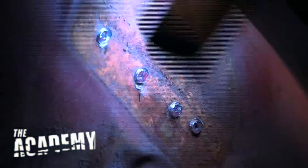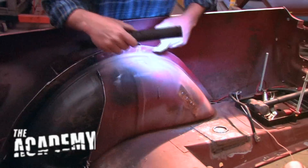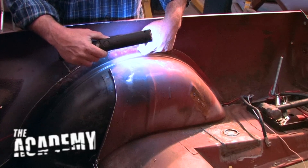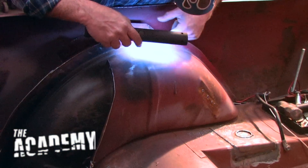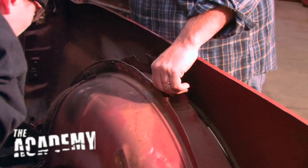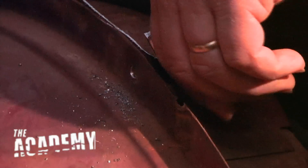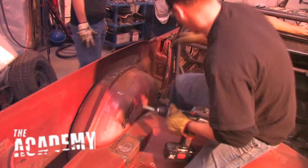You were through it enough — see the little bit of rust that's behind that panel. You'll always see that when you drill it. When you see a little puff of that dust come up, you're all the way through it. On these up here you can actually use a drill bit instead of the spot weld cutter — just take a regular drill and drill all the way through, because that's where we're going to weld the new panel back in. It's going to come down on this back side, and we've got to have a hole through this anyway to plug weld it together. So you can use that step bit — it's a lot easier to drill through, then you can drill through it big enough to get that off. When it's drilled all the way through and loose, this should pop right off.